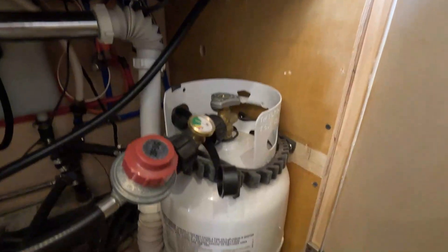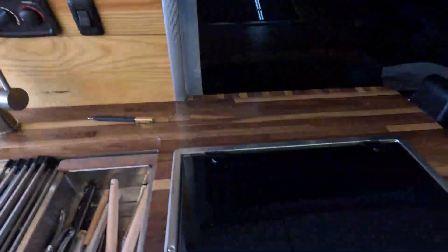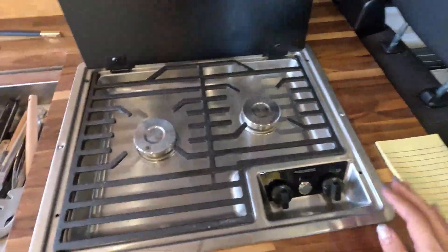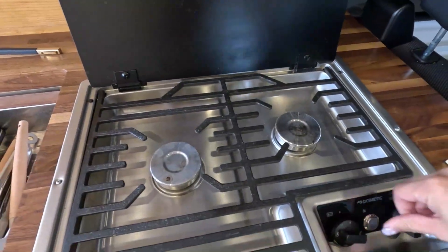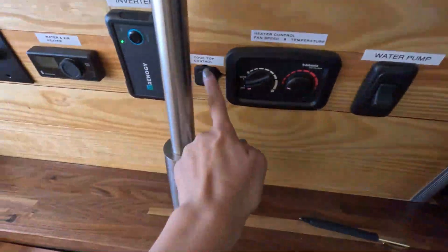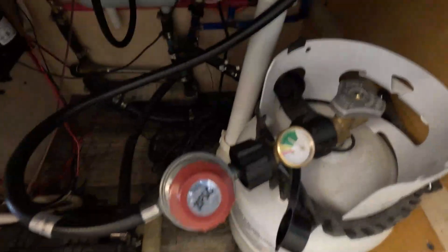This is where the propane is located. Your cooktop will be using the propane, which we'll go through here in a bit. There's one button here that's for cooktop control. The cooktop is right here. To use it, it's on a double safety — right now the cooktop control is not on, and even if the propane tank is on, you cannot make it work. For it to work, you have to turn on the cooktop control to see a light, and make sure your propane is on.